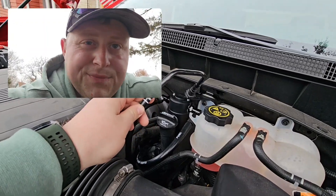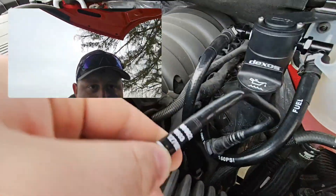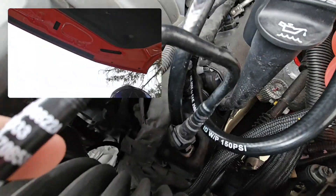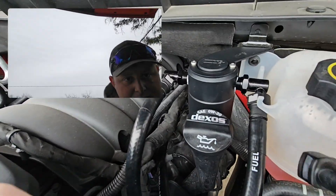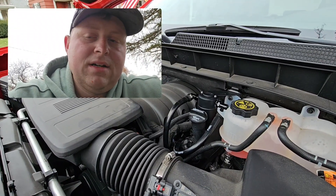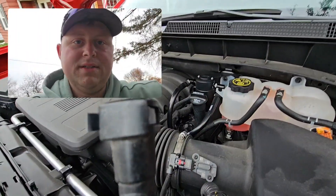One side has kind of a little filter thing. You're going to connect the small hose on the left side — they'll stay in there — down to this spot where this old hose was at, right here. The instructions will tell you. Then this old one connects to a spot back there; that's where you put the long hose. It should look something like this.